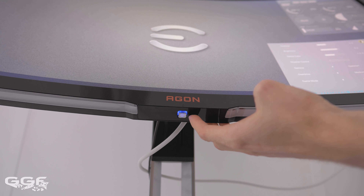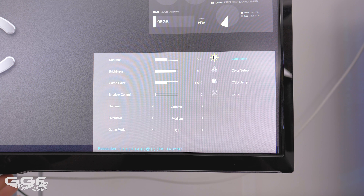The OSD has a plethora of options, but there's no picture-in-picture, which isn't a major issue as that feature is more for production work. A common feature in these gaming screens is overdrive mode, which basically boosts pixel response when needed. Setting this to off, weak, or light showed very little noticeable difference. Setting it to medium saw some response improvement with very little overshooting. On strong, there was too much overshooting and it was quite distracting. I'd stick to medium for this setting.